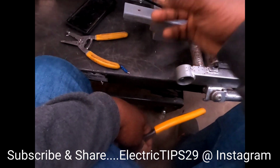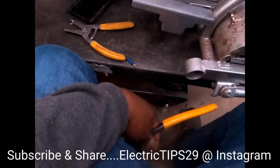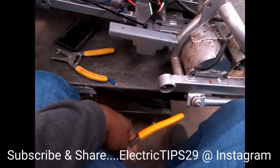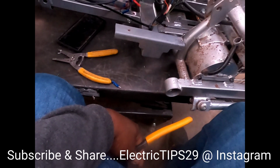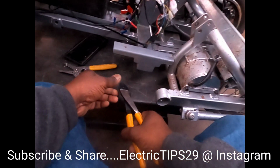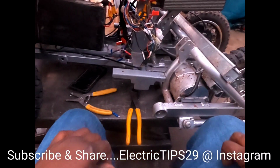That's a good thing. But if you unplugged the controller with power still in it and accidentally touched anything, you could mess up the controller, you could mess up the displays, you could burn out the throttle, you could have the throttle halfway working. There are a lot of different scenarios.